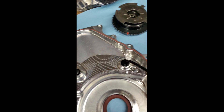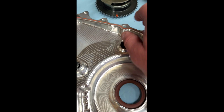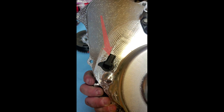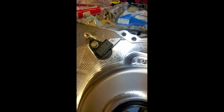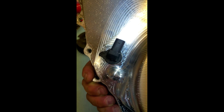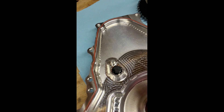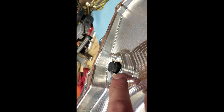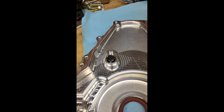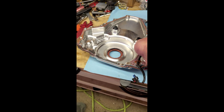If you go with this LME setup, I would use some Seal-All on this one sensor here on this side. The other sensor bolts in with a nice o-ring so it's tight — no oil leakage, no blow-by gases getting out. But this one wiggled a bit because it uses flimsy plastic tabs to lock in place. Use some Seal-All, do yourself a favor, lock it in place and you'll be good to go.